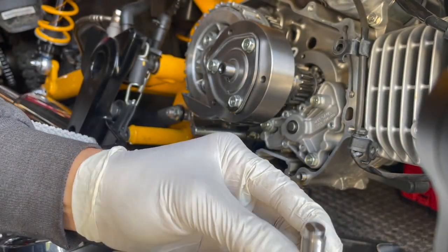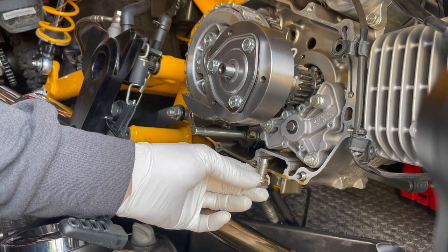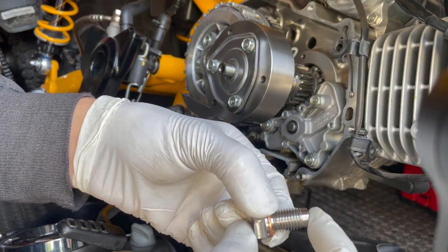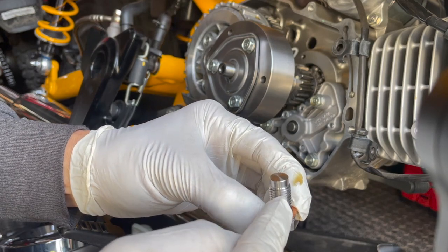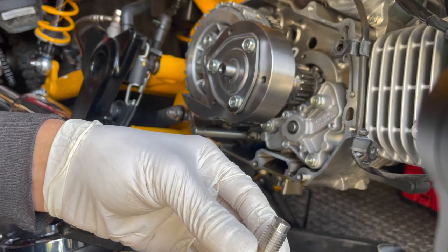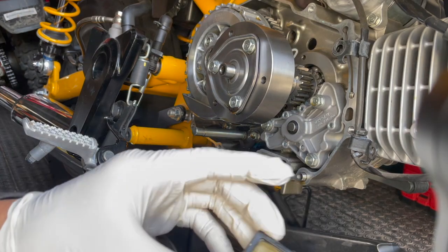With this one, the magnet is actually inside — it's been drilled in right here, so the magnet is fully enclosed. That's why I'm going to replace the old plug with this. It is kind of long because these were bought for BMW applications, and I just bought them because the thread pitch and diameter are the same. Anyway, so I cleaned out the screen.